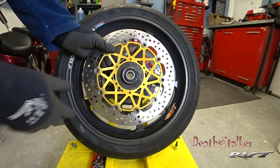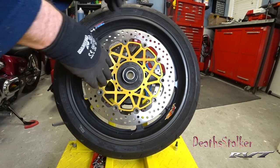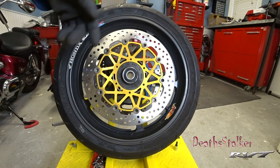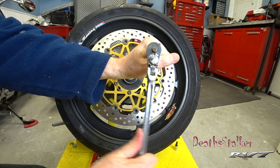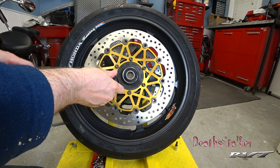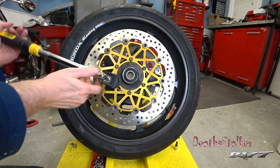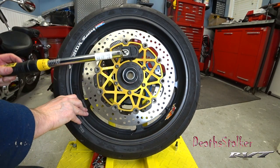I'm going to put the new disc on the bike. In case you notice it's rattling — the old disc had been on for so long and got caught in so many rainstorms it had actually started to seize up. Even though those have Loctite on them, there is actually a torque value so we are going to torque them — it's 14 foot-pounds or 20 newton meters or something like that. It's actually not very high.